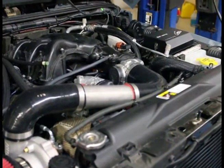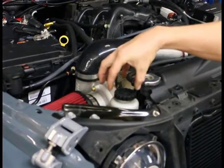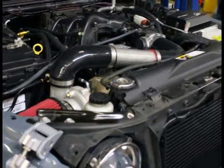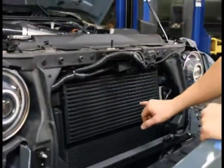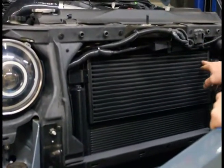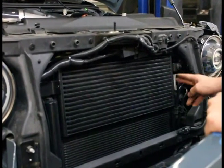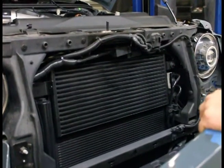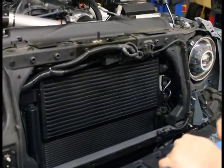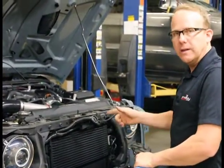Also in this process, we'll be taking the power steering reservoir — we'll be modifying just the bracket — it's going to go up and a little bit to the passenger side to allow clearance for this to come through. We'll also be removing the factory transmission cooler if it's automatic transmission equipped, like this vehicle is. We'll replace it with one supplied, and that will remove these hoses or pipes here as well. But real simple — just overview — removing the charge pipe, adding the front mount intercooler, and on this one side there is a power steering hose that gets replaced.